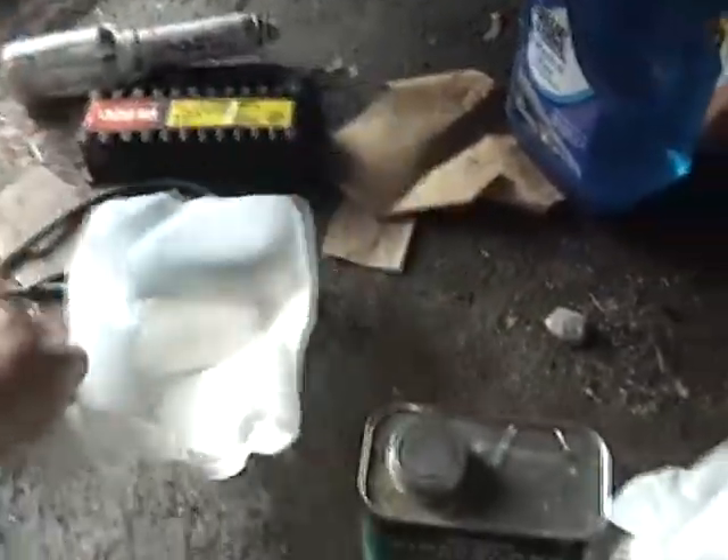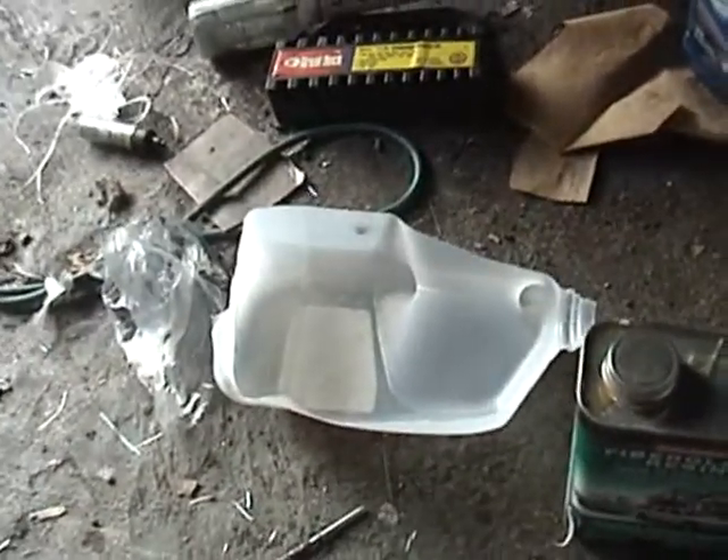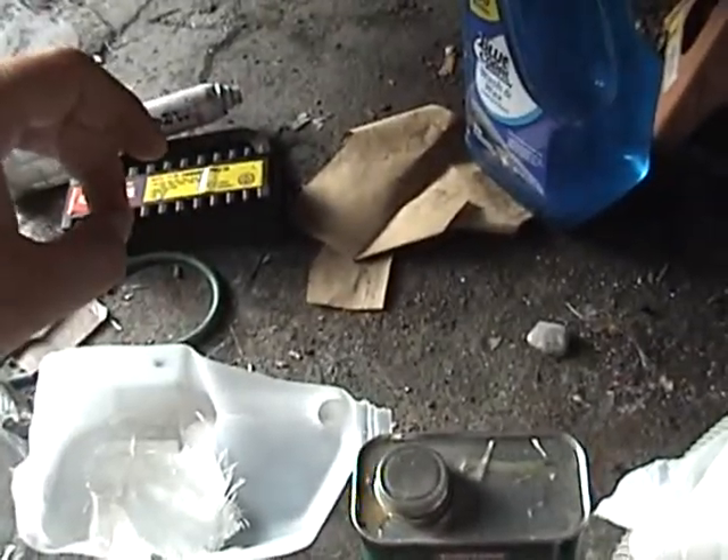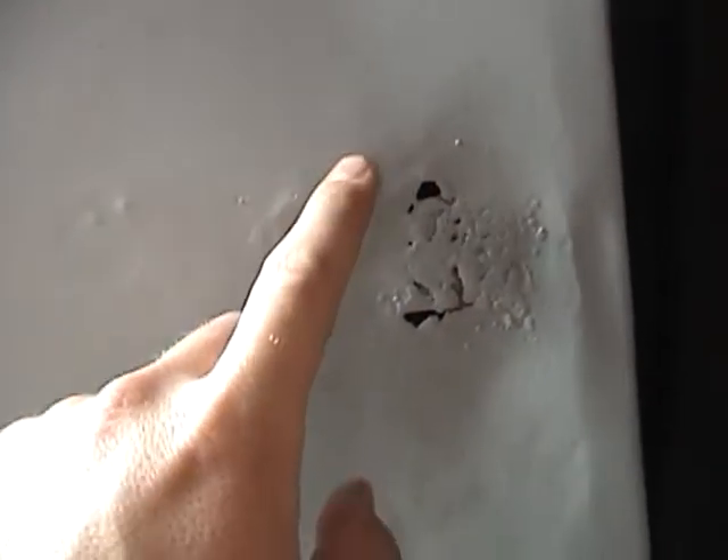You only have a fairly short working time. I cut an old milk bottle in half and use these as my mixing trays — cheap, easy to come by, easily disposable. You wear rubber gloves, you brush the resin onto the fiberglass squares. When it's dry, you sand it smooth, and after that's done, I'm going to Bondo over it. I'll show you all of that step by step, and I'll probably have to continue this video tomorrow.